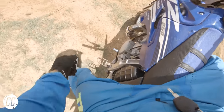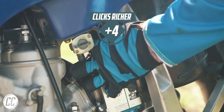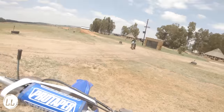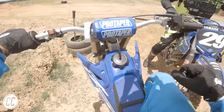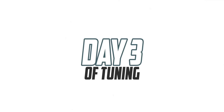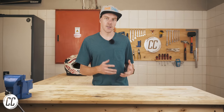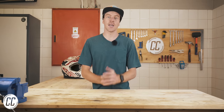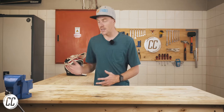So this is how my tuning experience went down. First, it wouldn't idle and had low power down low, so I went 4 clicks richer — because in my mind, more fuel meant more power. But this didn't work. Nathan then told me that they shipped the carbs on the richer side to prevent engine damage, so I should go leaner until my revs start to pick up. Turns out I was going in the wrong direction, but I do appreciate that they shipped them on the richer side to protect my engine.